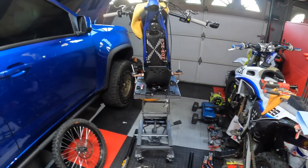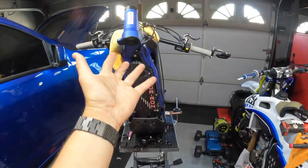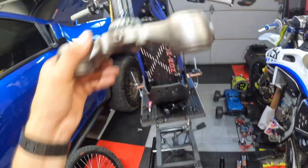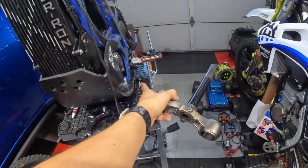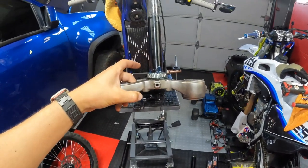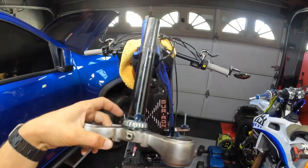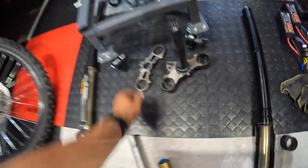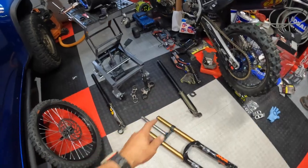Alright boys — there it is, got everything off. Front tire off, wheel assembly off. That's pretty simple to do. Everything pops out pretty easy. The only thing is when you're trying to take the handlebars off while the stem is still all the way up, after getting your cap off the middle of the stem insert, I grabbed this portion with one hand, grabbed the handlebars with the other, rotated them counter to each other while pushing up on the bar, and it slipped out. We've got our dust cover and a spacer that was on the OG fork setup.